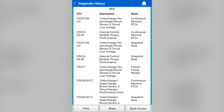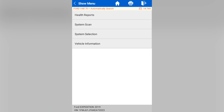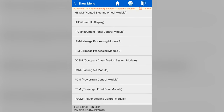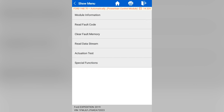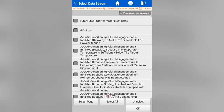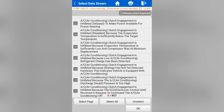There were a little discrepancies in the name, but I thought this would be a good addition to the unboxing video to show how I found the data PID for that. Just going to go to my engine computer. Imagine you're 250 miles into a thousand mile trip and you get this — you can hardly drive the vehicle. It was very low power, surging, bucking. So: read data stream. Ford's pretty typical with this — they don't give you separate data lists and it's tough to navigate through. It's better when they're grouped, but that's a Ford thing.